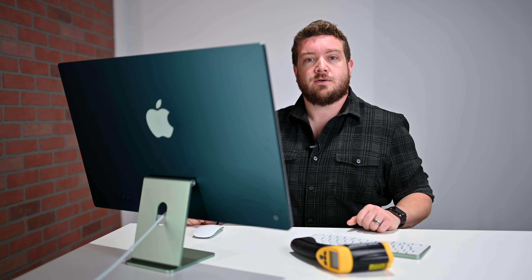Why are we testing this? Why do we care? Well, Apple kind of brought us here with one of its MacBook Pro models. Apple actually did have a big thermal throttling issue where the processor would get too hot and have to clock down to maintain performance — going well below the advertised clock speeds that Apple and Intel were promising. You're paying for something supposed to be like a 3.2 GHz processor and getting something like 2.8 GHz, and that is not okay.